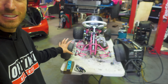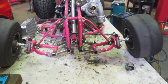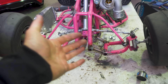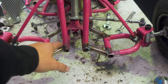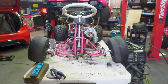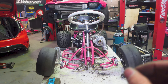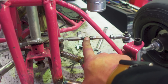We now have a widened front end on our drift cart and it looks so much better. Look how much tidier the bar work is now. We still have to tear this whole thing apart, finish all the welds, tidy everything up on the frame, and repaint the frame. So I've only welded the top half of all of this piping and I'll tidy it up afterwards. I'm definitely super happy with how that looks — much nicer, and it's given us a bunch more room on either side of the cart. That said, it's still going to be a really tight fit for our intercooler piping. I also had to extend our tie rods here as well.